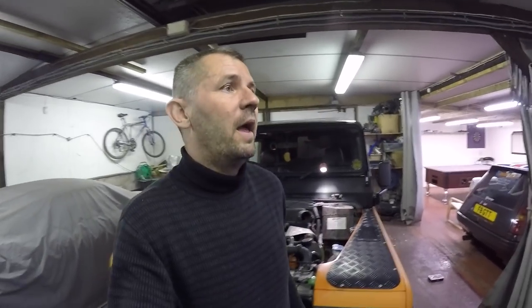It feels all right now, back to normal. All good. More boost. So that's pretty much it. Didn't go too bad. Had the studs out in the back of the head there. Managed to get away with putting some longer studs in, like I showed you. But you can always helicoil them. They're easy to get to. It's not a head off job or anything like that, so that's not too bad.